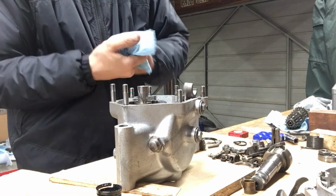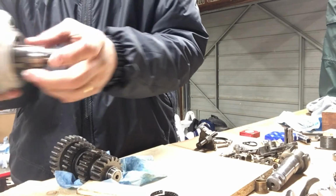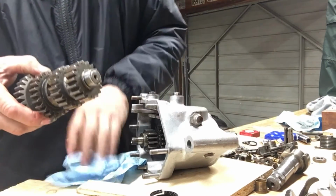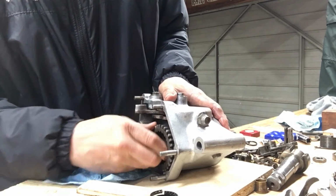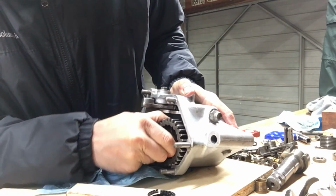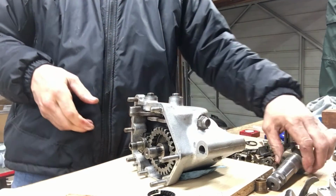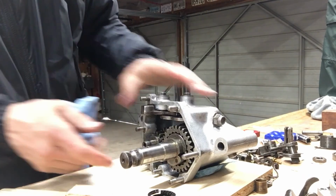Okay, anyways. I got to take off, run an errand. I'm going to come back and finish this. Yeah, I put the main shaft in first, and it's a pretty snug fit in that bearing in here. So I had to put the nut on the end here and just give her a couple light taps to get it in there so you don't damage the threads. And then we'll stick the lay shaft in there. So the gears fit nice and flush here. That's in all the way. Kickstarter shaft goes on in like that. It's getting there, but I gotta take off now. Okay.